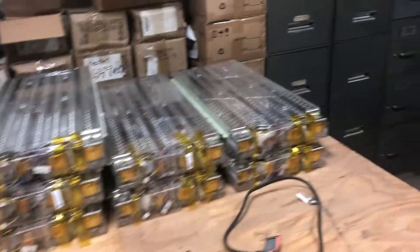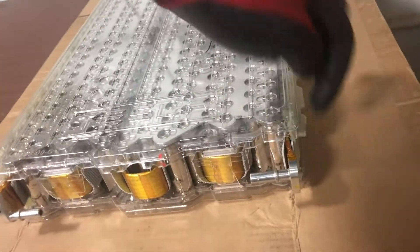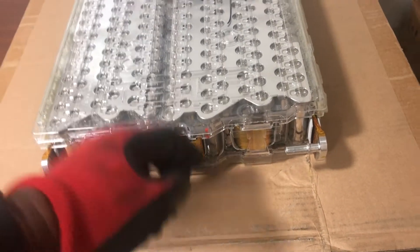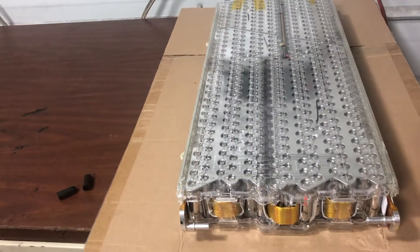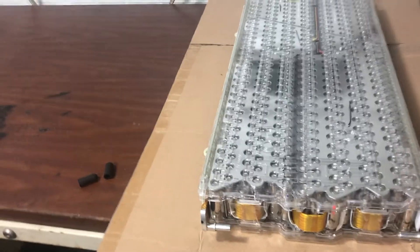I'm getting ready to perform a leak test on these Tesla module packs. On these modules, on the opposite side — the non-conductive side — there are two inlets: one's an inlet, one's an outlet. These nipples here go to passages that run up along through the batteries on either side of the row. That is to circulate coolant, which gets pressed against the battery and keeps it at an optimal temperature. I'm not sure what the PSI is — in this case it would be gallons per minute — just enough to keep coolant constantly flowing past the batteries to keep them at optimal temperature under load.